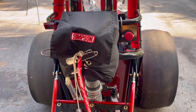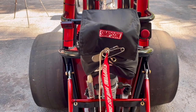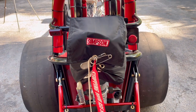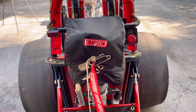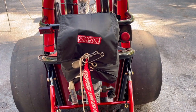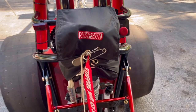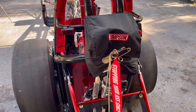All right, guys, first order we're going to talk about is the actual parachute. So this parachute is from Simpson Race Products that I did get through Holley. For everything we've shown here, I'm going to put the part numbers in the description and link them so you can go check them out. This is the Skyjacker. It's the 10-foot chute. They are handmade cross-form designs, and they're good up to 200 miles an hour. This car is capable of up to 200 miles an hour per the chassis certification.